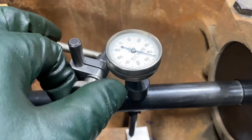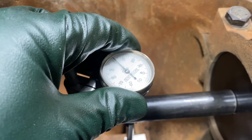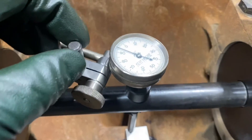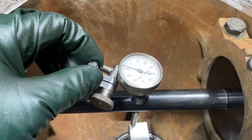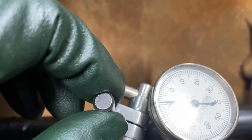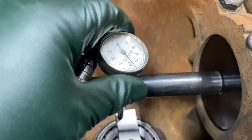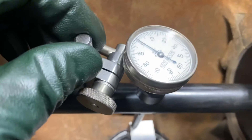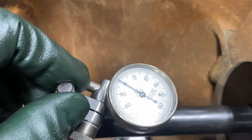I'm going to tighten this up a little bit since I'm doing this one-handed. We'll preload about 50, so that puts us right about zero. Now, what I want to do is find my zero. I'm going to go to my greatest point of deflection, which is pretty close to there. I'm going the other way. Take this up just a little bit more here. Pull this up and go back to my 50 thereabouts. That's pretty close to zero — you're going back and forth.